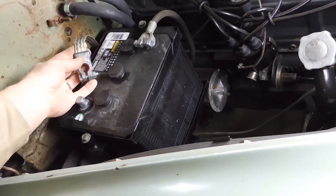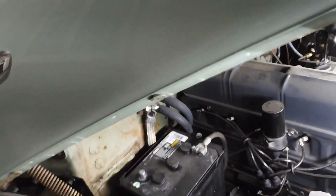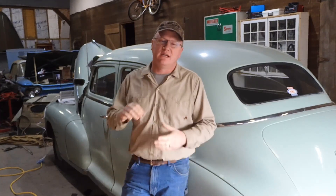Our ground strap is nice, clean, good shape, nice wide one — very important on these things. When you go to the burger joint and get a milkshake and they give you a regular straw, you about blow your lips off trying to suck it up. What you need is the big fat straw, two or three times regular size. That's what's going on with your 4 or 2 gauge battery cables bought in the '80s from Alco or Ben Franklin — get those things off of there. If it has plastic insulation, it's more than likely not enough. You've got to have something big enough for those electrons to flow through.